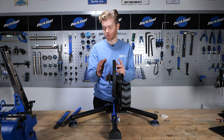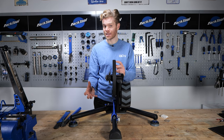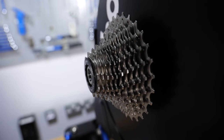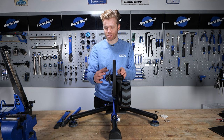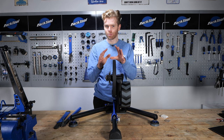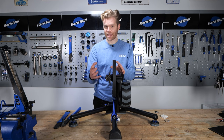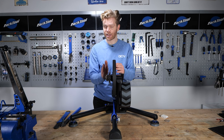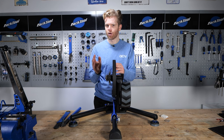The first thing that can be the cause is actually that the cassette and chain is worn on your bike, and then you've got a brand new posh turbo trainer for Christmas and it's got a nice new cassette on it. That worn chain doesn't mesh properly with a nice new cassette. Assuming that your bike is clean and not completely worn out and that the cassette is functioning as it should be, the most likely cause is that the spacing of the cassette is different on the trainer to what it is on your bike.